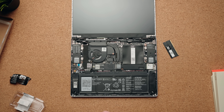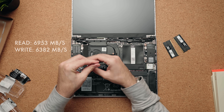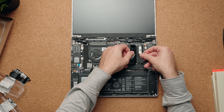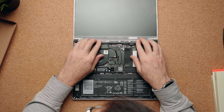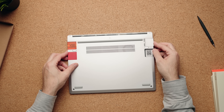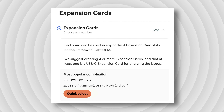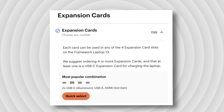Of course, I didn't read the instructions — I'm a certified maniac. But I jammed in a 1TB WD Black SSD, which got good read and write speeds, slapped in both 16GB RAM sticks — upgradable to 96GB, by the way — clicked in the bezel, snapped the keyboard in place, and picked my ports: two USB-C running at USB 4.0 speeds, one USB-A, one HDMI. According to Framework, that's the most popular port combo, but the flexibility is the fun part.